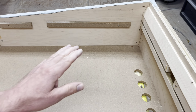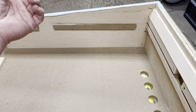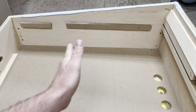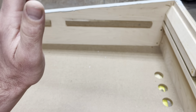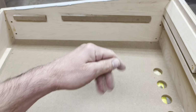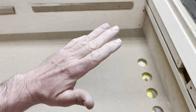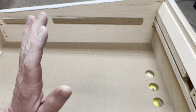I like to do that because even if they measure out right, it's better for them to be a little bit further back, because if you happen to use aftermarket glass channels or a CPR back glass, it's not going to fit as nicely as the original. It's usually going to be a little bit tighter, so I like to make sure I've got some real estate there. If it were to fit a little bit on the looser side, I can just put some target foam here to stiffen it up. But you'd much rather have these parts fit a little bit loose than too tight.